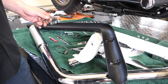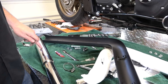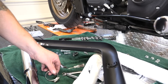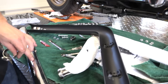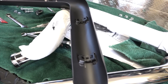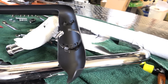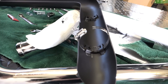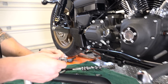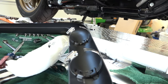Your kit comes with two different size hose clamps. The larger ones are for the larger diameter of the pipe where it flares up — those go in the back. The smaller ones are for the smaller portion of the pipe. We're just going to start taking these apart and feeding them through the channels in the heat shields. He fed his first small one through — they just go through the channels like so. You take each one apart with a screwdriver, spread it apart, and work it through the channel.